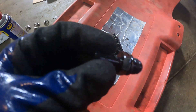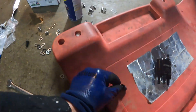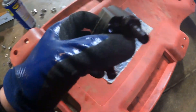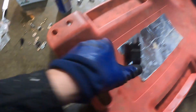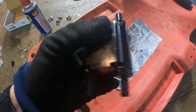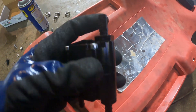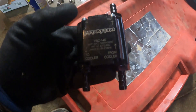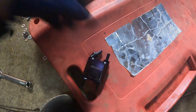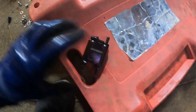First things first, we have these fittings — I think they're 5/16 fittings for the oil lines. They provide O-rings: you just put those O-rings on the fittings and screw them in. Do not over-tighten — I just held it with one hand and with the other tightened until it stopped. You don't want to go crazy tight because I think these are aluminum; you'll break the threads off. It takes a 17-millimeter wrench to put these in.